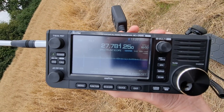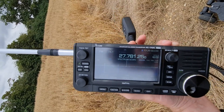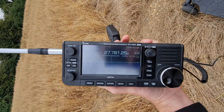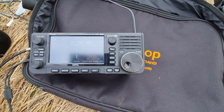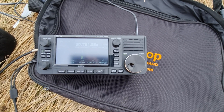I'm getting a fairly good SWR as well. I'm using this battery pack so I can run full power on this radio. I've had to adjust the antenna a little bit because I think it's acting as a bit of a counterpoise, but it seems to be working pretty well. Station in Henham, copy - hello mate, you've got Andy over this way. I'm in Harlow so a little way away from you, but not too far. I've whipped out the mag loop and the difference is night and day - really impressive. Henham is probably about 15 miles away from me, maybe a bit further and more elevated, but it works well. The mag loop is just amazing.